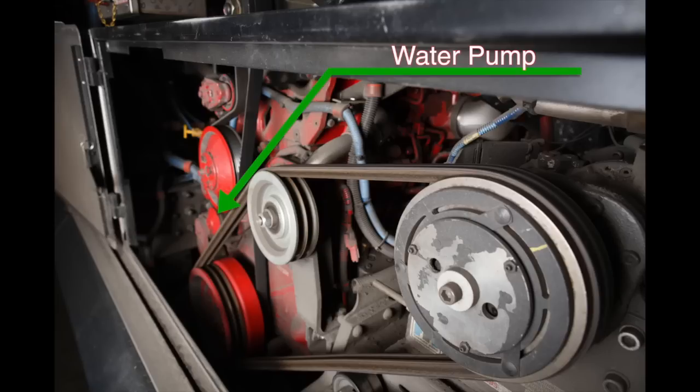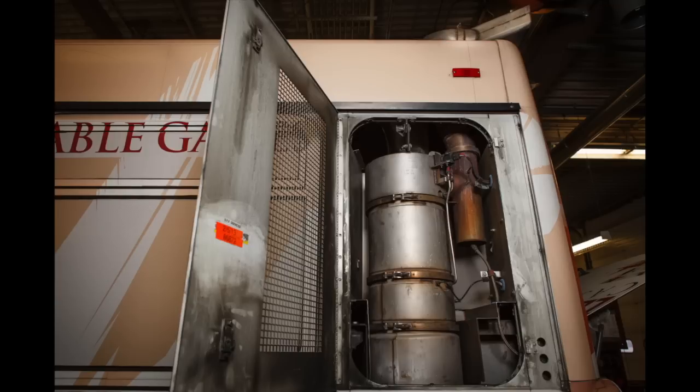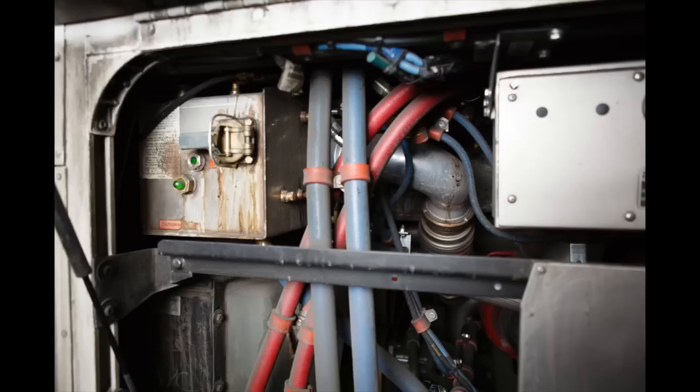Check for missing nuts or bolts. Check that the hoses show no signs of abrasions, bulges, cuts, or cracks, and there is no damage from parts rubbing together. Identify the exhaust system and make sure it is securely mounted and tightly connected with no loose or missing nuts, bolts, clamps, or mounting brackets. There should be no signs of cracks, holes, severe dents, exhaust leaks, rust, or carbon soot.